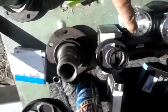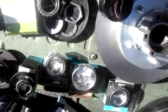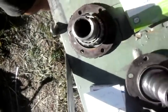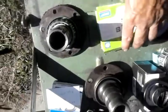So that would be on the outside of the bearing. I mean, the last one you put in. Inside, larger. Outside, same for all Internationals. But the inside of this one, which is the original bearing, is an A35. So we have a different seal, a modified seal, the same bearing. The race is already installed. I don't have that part number for you. And so now we know how to retrofit either a disc brake setup original or a drum brake setup original